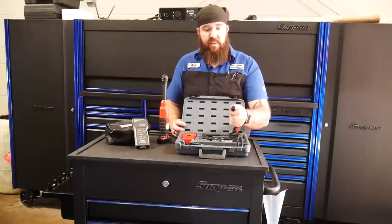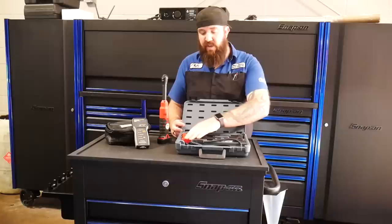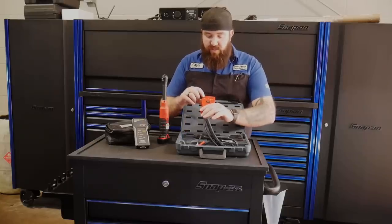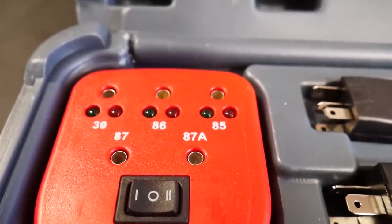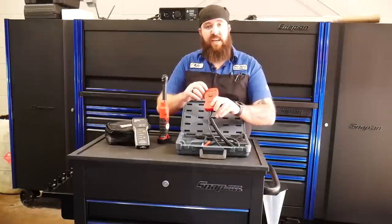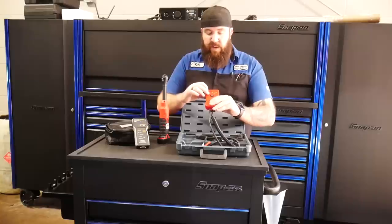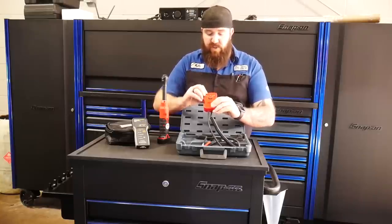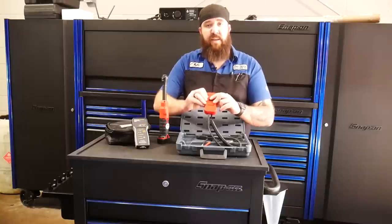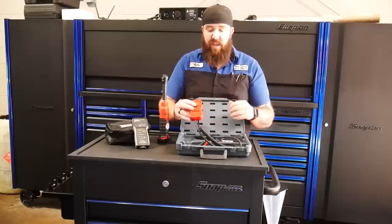When you plug these in, you're going to plug them right in here to the end of the kit, and then you've got a positive and negative that you hook to your battery. When you plug it in, the little circuit tester is going to do an initial check of the circuits — it's going to tell you what has power and what has ground. Each one of these little indicators on the unit has a red and a green indicator: red indicates power, green indicates ground. It also has little banana jump leads where you can put the leads to your meter in to test for voltage or whatever you need at those points. The standard middle position of the rocker switch is off, then you move it to position one, which actuates the 87, and position two would be the 87A if that circuit is available in the relay you're testing.